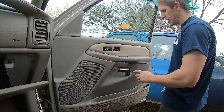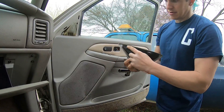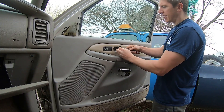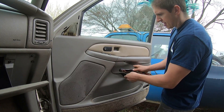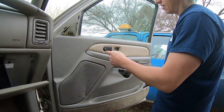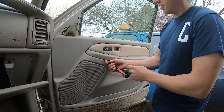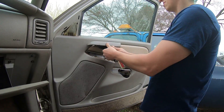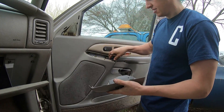The first thing I do is pull off the little plastic clips. Up here by your mirror it's just held on with two little clips — you pull out and it comes off. Your lock switch: pry at the back and it pops right out. The plastics around the door handle also have those little clips — pry those out and pull it out. Then before you do any screws, pop your switch panel off: get your screwdriver underneath the outside edge and pull it up and it pops right out.